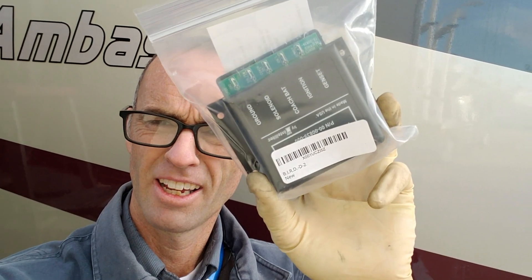So what we're going to do: he wants to charge the chassis batteries when it's plugged in. I gave him the option of just getting a battery tender to plug in, but since he's not around very often he doesn't want to hook that up and unhook it each time, and there's no 110 outlet by the batteries. So we're going to install a bi-directional isolator relay, remove the old isolator relay, so it charges the chassis batteries when plugged in and still charges the house batteries when running the engine. The auxiliary start will still work.